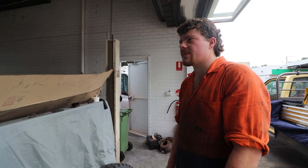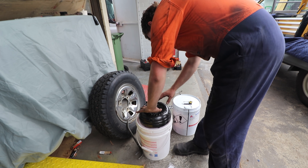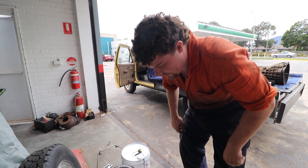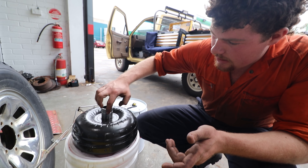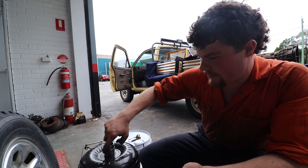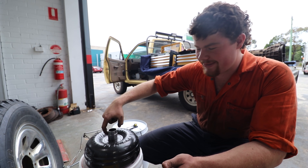The steel centre is out of a different Nissan converter. It's all set up as standard - it's not a low or a high stall or anything, just standard stall. There was an option to do whatever, but it's a standard motor and it's getting used for four-wheel driving, so there's no point putting a high stall in it.